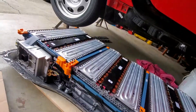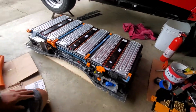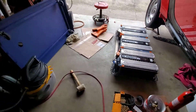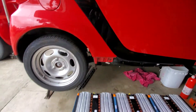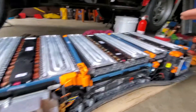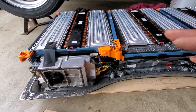Right there — it's pretty much no indication of burn or whatever. All we need to do is recover the dead cell. The cover is pretty much no history of damage or burn, so I'm happy with that. It's simply that the previous owner accidentally hit something, and then the airbag sensor — as you can see — the airbag deployed, and there's a connection on that airbag sending a signal to the BMS. Once the sensors activate on the airbag, it automatically shuts off the whole lithium battery — that's for safety. That's the purpose of the BMS.